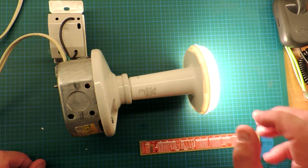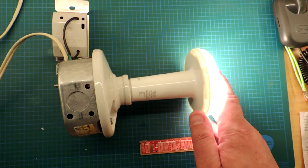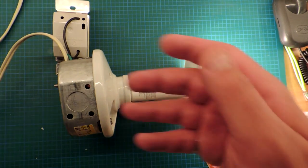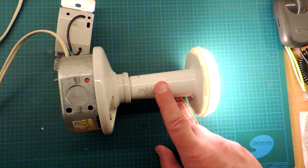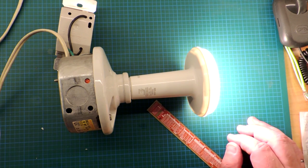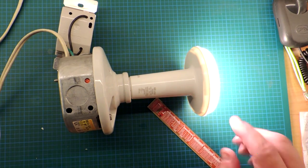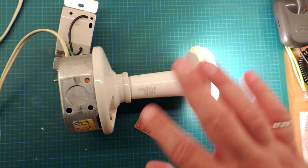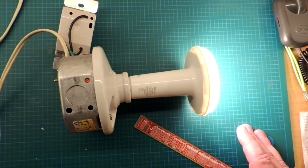Let's talk about something relatively unique on this bulb. When the bulb is used with a dimmer — whether a dimmer that predates LEDs or even one explicitly meant for LEDs — we put a microphone on the bulb and you can actually hear a buzzing sound. I'll inset that sound and amplify it a bit. It's quite annoying. In fact, I don't think I've ever seen an LED bulb, other than the Slim Style, where there's actually an audio component — where you can actually hear the bulb operating. If I take the dimmers off, that sound seems to go away, so it's only a dimmer-type phenomenon.